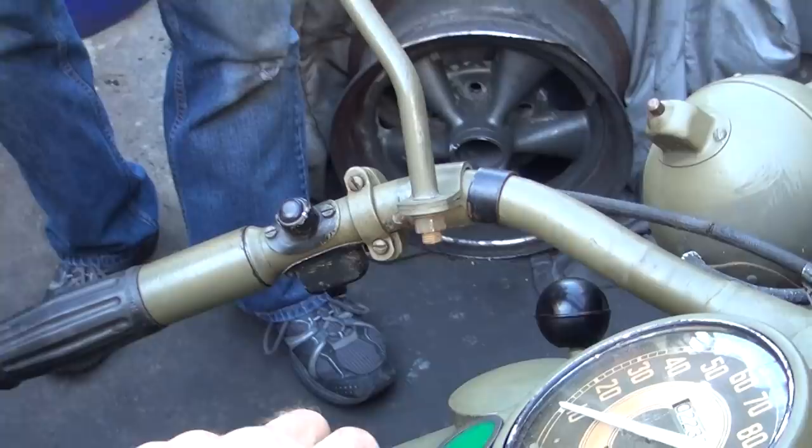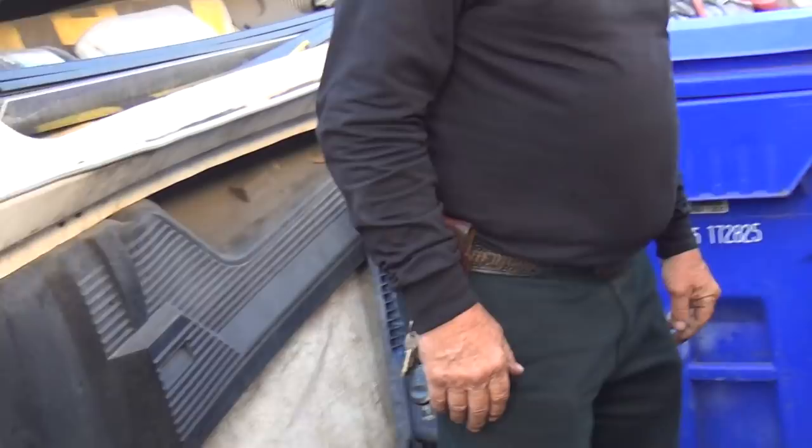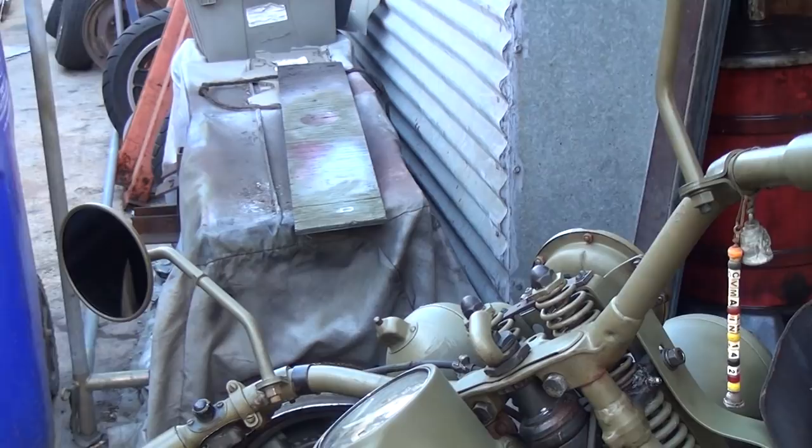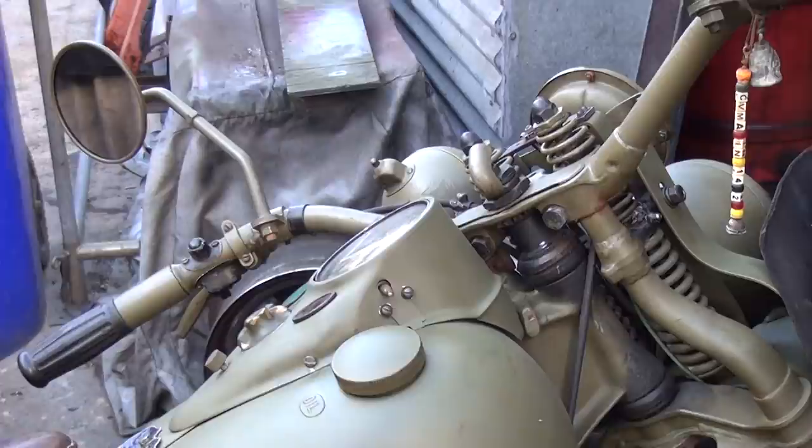You notice the variable throttle positioning when you turn the handlebars. Yeah, well, why is that? Because someone didn't put the bike together correctly. The throttle cable is obviously pulling when you turn the handlebar. You would think it would be stretched out being in this position, not straight ahead or to the other direction, but it is. So, when you put the bike together,